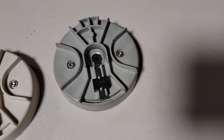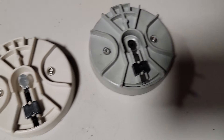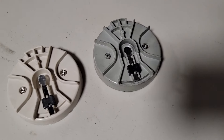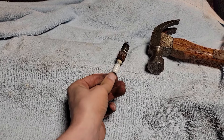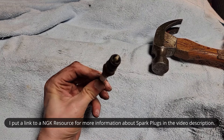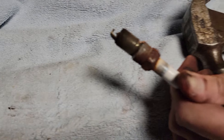Here you can see the two rotors — the gray one is the old one. There's a little corrosion on the end and toward the center, which is just normal use. We could file it down and it'd be okay, but we have a brand new one right out of the box. My friend Anthony is working on the spark plugs. We've got one out that's burning white, which means it's running a little lean or too hot. We'll get all eight out.